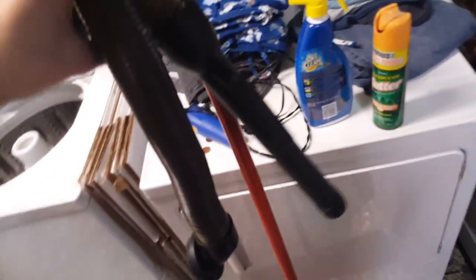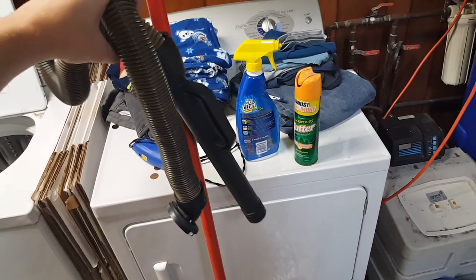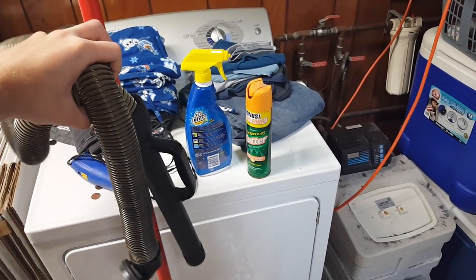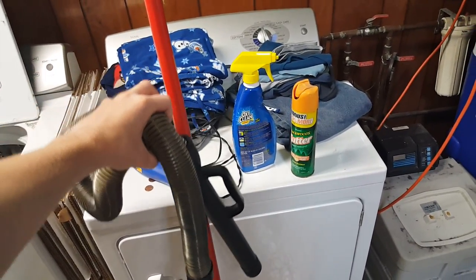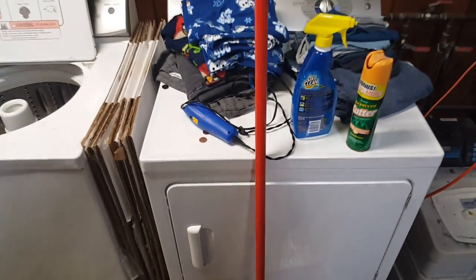Pull this off. Once you get the clog out, there you go. So basically just stick a broom handle in the hose and push whatever is stuck in it. So if you experience a loss of suction in your hose or another part — well, probably the hose of your vacuum is clogged — then definitely use a broom handle, because that works pretty well.